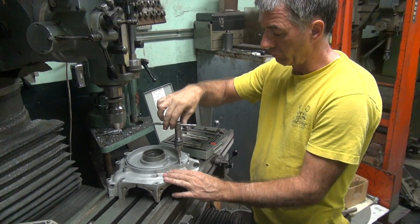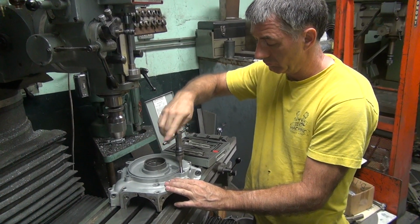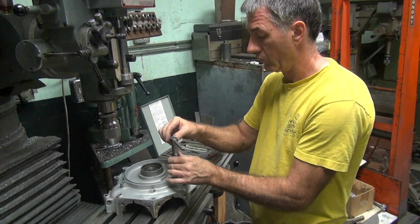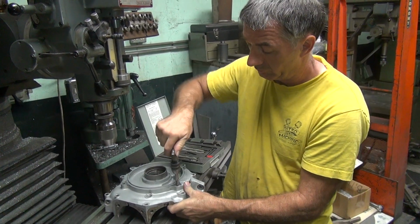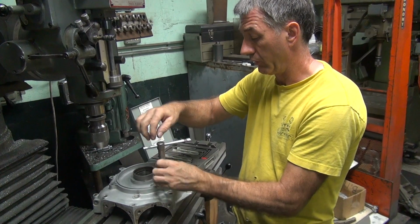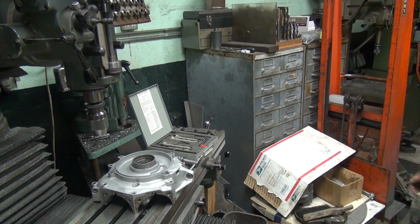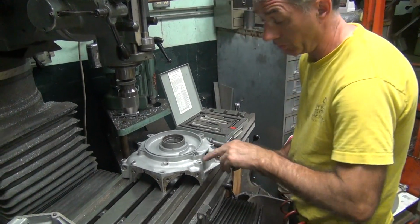So let's kind of find its own center point. Hopefully not cut much. So once you get in there, see I got it nice and firm. Once you get past all them bad threads, they're probably about the first 1/4 inch, things get better. That means if you go deep enough, we'll have some good threads. Bad part is, we're moving metal.